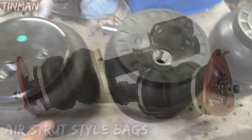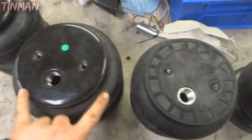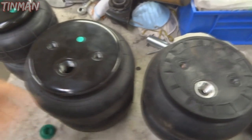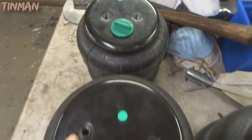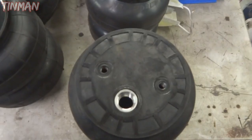Looking at these, you can see they're pretty much identical in design - they have the same exact half-inch port and the same mounting flange distance. That's nice so you can use the same bracketry and switch bags easily. The bigger D2600 has a bigger mounting flange versus the D2500, which has a smaller distance between the mounting flanges. It's similar with the SLAM bags - larger and smaller.